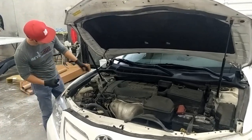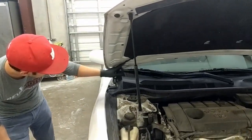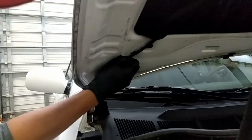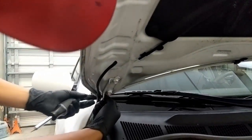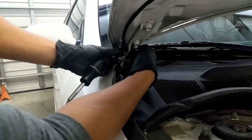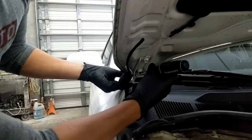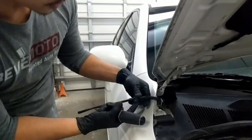You're going to start off with disconnecting the windshield washer nozzle fluid — it's going to be the hose right here. It's pretty simple. Come over here and just pull on this, it disconnects right away. It's going to be like a push system right here, so just put your hand here, push one of the connecting rods over, then get a flat head and push that down. Then it comes right off — it looks just like this.